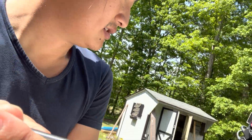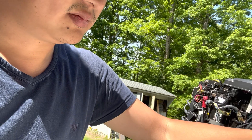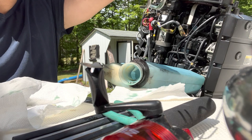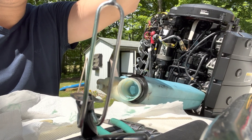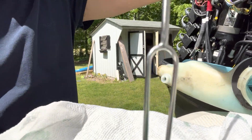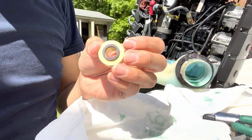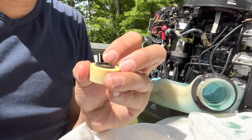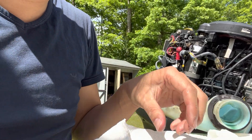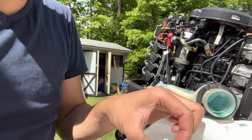You insert this tool all the way to the bottom. To simulate it: the piece is sitting on the pillar and your hook has to go in, prop it off, and pull it all the way out. Then you can pull the other parts out with the hook. Now you can glue your magnet back to the float or tie it off with a fishing line — however you think will fix it best so it doesn't happen again.